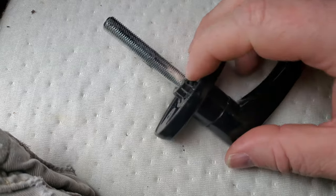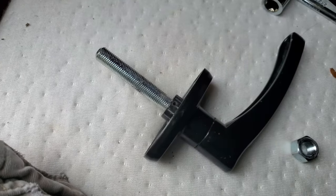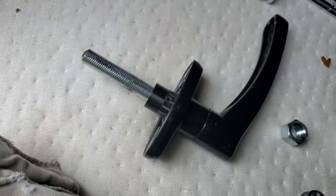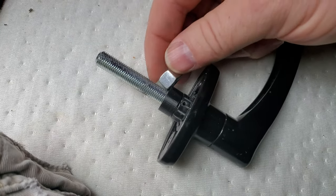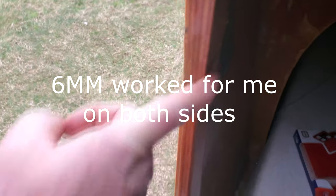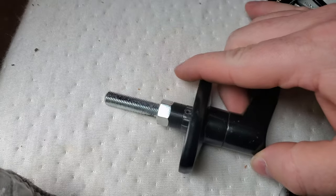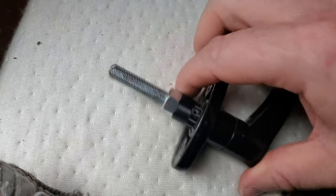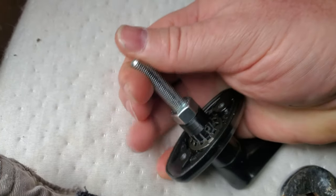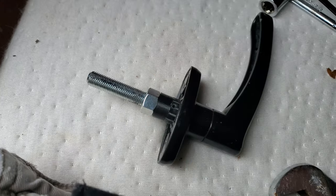The threaded rod is inserted and they drill a hole through it at the factory and put a pin in that gives room for play and wobbling. We take a 3D-printed little piece, give it a backer, tighten the nut down backwards — you have to figure out your distance between here and here for the door to actually clamp. By doing that, there is no longer any play. You can do the same thing with washers, but I 3D printed the part. Now insert it back into the door, put the screws in, and keep assembling.